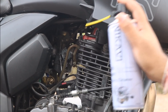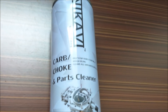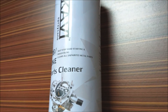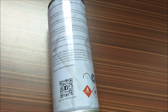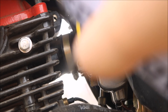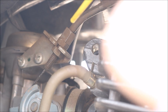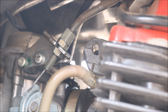Let's start by cleaning the exterior of the carburetor. Here I am using the Nikavi carburetor and parts cleaner spray. You can use this to clean the exteriors as well as the interior of the carburetor, and I have used this for other maintenance purposes which you will see in upcoming videos. Please note you should never use this on a hot engine as the contents of the spray are highly flammable. Also never use diesel or any other strong degreaser on a carburetor as they tend to leave a thin layer which can attract dirt and dust. As you can see, the cleaner is very efficient in cleaning with no additional effort required.